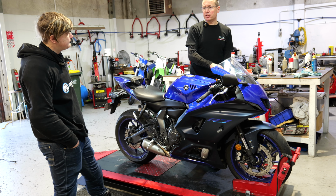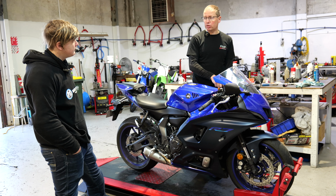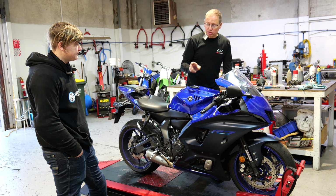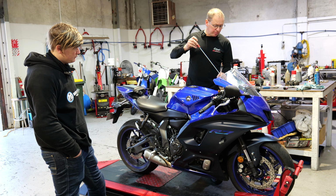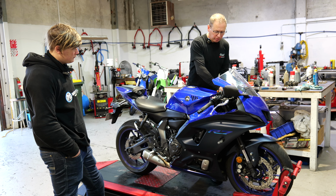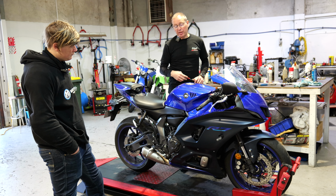So what's happened, this has been adjusted. Because the spring was so soft, to try and slow the fork down and stop you bombing out, you put compression on, which is absolutely the right thing to do, but the spring hadn't been adjusted for you first. So now that we've adjusted the spring for you, we can take a bit of that compression damping off. It's still too fast, but it allows the damper to control the fork a bit better. So ultimately, that's the best we can do.